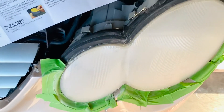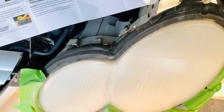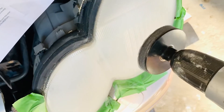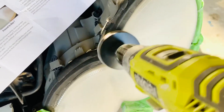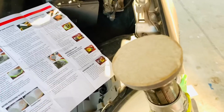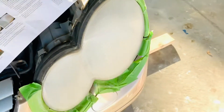A slow and steady back-and-forth action will be most effective. When the disc is clogged — like mine is — it's not yellow anymore because I've been sanding already. Use a back-and-forth motion with light to medium pressure; don't stay in one spot. Just back and forth, back and forth. Yeah, it's clogged up — I have to replace it with another gold disc.